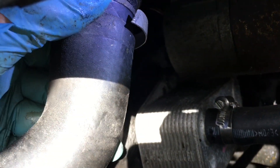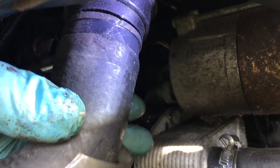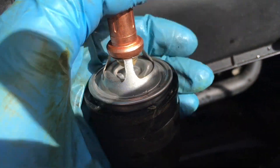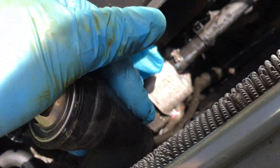To block the pipe when the water gushes out, I've got tissue put inside a rubber glove which we can jam inside the hole. That's a quick block of the pipe on the engine side — lost a little bit of coolant, not too much. Here's the thermostat we're putting in; see the video description for links for buying this thermostat.